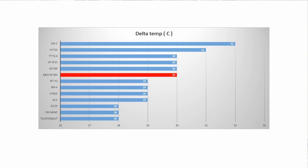As you can see in the chart on the screen, it's the same chart we used for our other 12 thermal pastes, with this thermal paste highlighted. It's called the ZP360 on the tube, but there's no manufacturer listed, so I called it the eBay ZP360 in the chart. It was tested over 30 days on my Ryzen 3 test bench, overclocked to 3.9 GHz using 1.35 volts. All thermal pastes were compared on the same test bench using the exact same cooler — the BeQuiet Slim cooler, which I also have a review of.